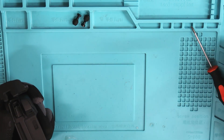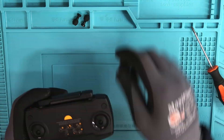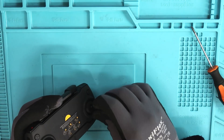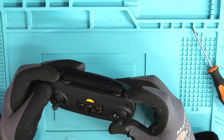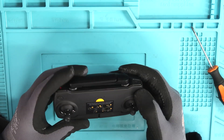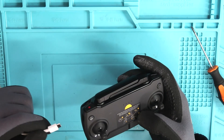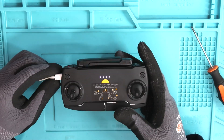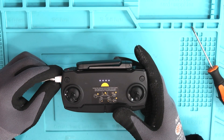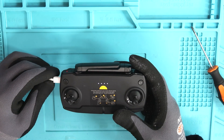We're pretty much wrapping it up here — the controller is back together. We're going to power it back on and make sure everything's working. Before you power the controller back on, you're going to have to plug it into a charger and let it go through a reboot sequence. This is going to happen anytime you unplug the battery from your controller. Go ahead and plug it into a five volt outlet — you'll see the controller turn on and then begin charging. Once you see it begin charging, you know you're ready to turn the controller on and verify everything's still working.